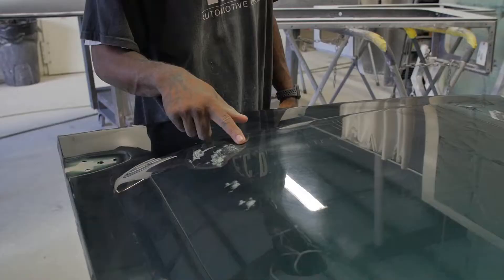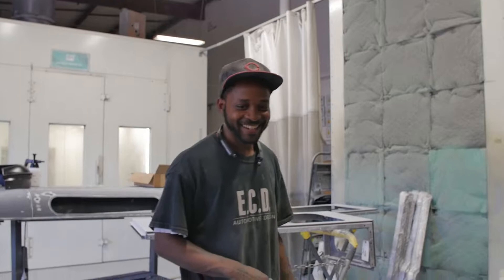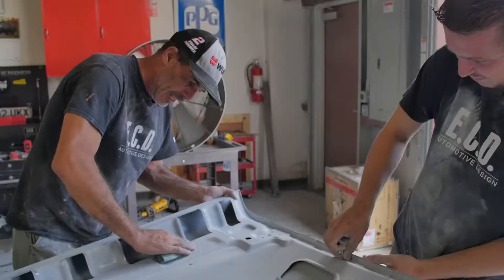The process I'm working on now is water-sanding the surface down, getting everything cleaned up. Then we're checking for any dents, stains, or scratches that we have to fix. We've got scratches, we've got dents. Basically, feeling with your hand is how you find the imperfections — feeling all over the body and making sure it's in shape.